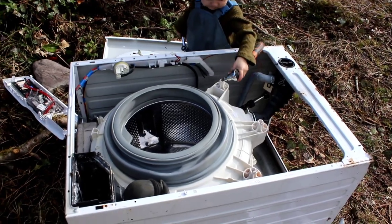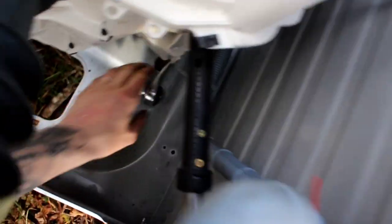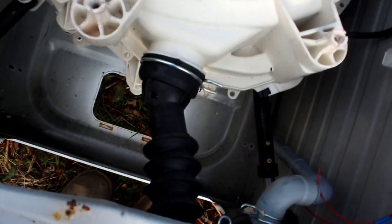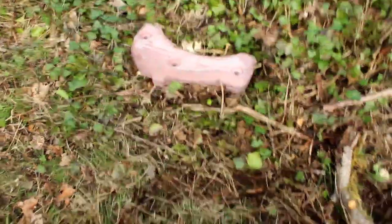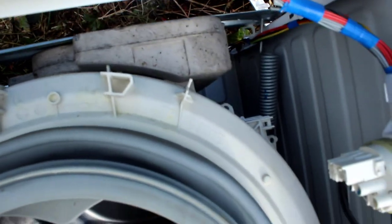We've made a mess of it. We've taken the front off. Although I've fixed these legs now with those screws, it's still bending quite a lot and it needs fixing at the top. Usually it's suspended by those springs, so I don't want to snap anything on these legs now that they're fixed. Taking the front off gives me better access to these springs and also a chance to take that concrete weight out — that was fastened here. That's going to be a lot less stress. There's another big concrete block on the top that would keep the washing machine still during its cycle, but we don't need that now.